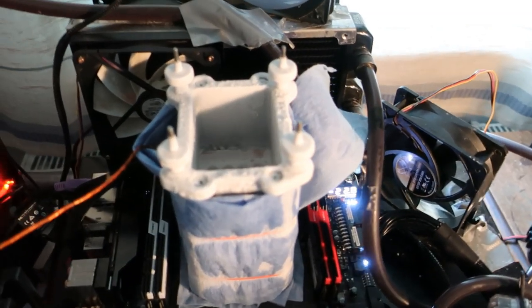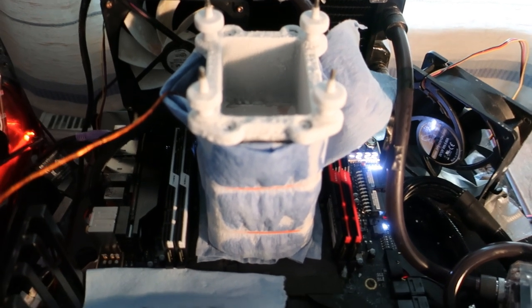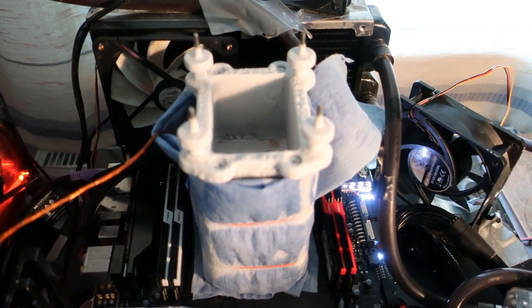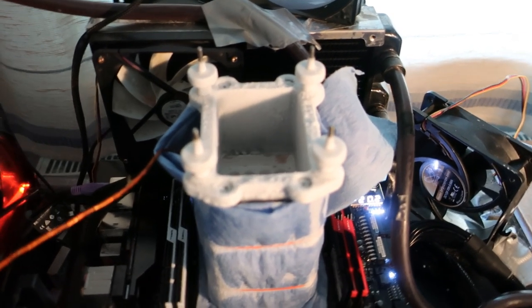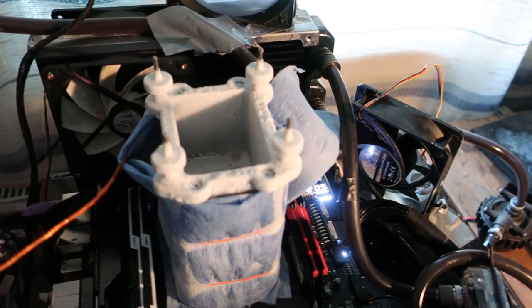Alright, so that's the end of my multiple day 9980XE LN2 session, so I did various. I did many different mounts on the CPU, and I can confirm that my thought or theory was right. So you can make the CPU thermal paste crack free by going really tight on the thumb nuts with pliers, but there's a real risk involved.